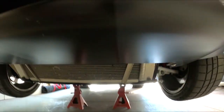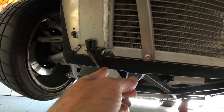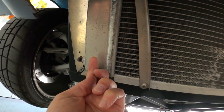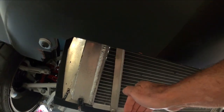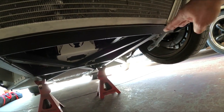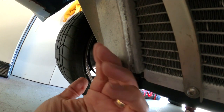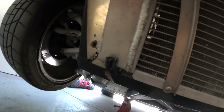That's where the raccoon I hit got it. So here's what I intend to do: I'm going to weld a piece of steel from here, right up inside this edge, and then bend it upward probably about an inch. Whatever gets in underneath this lip will catch and drive it underneath the car, protecting the radiator. This is going to go all the way across and stitch weld along the chassis, following that upward angle — probably just about an inch.